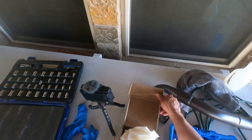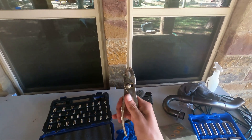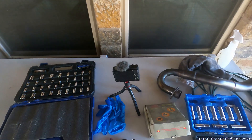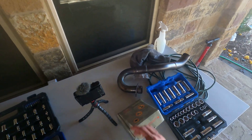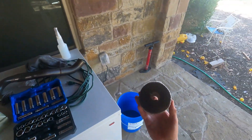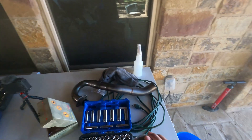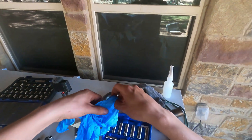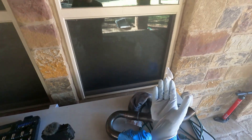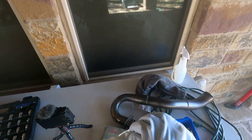Just got all this cleaned up. Now what we're going to want to do is get the heat wrap out. Some of the tools you're going to want are some wire cutters and some clippers. You're also going to need some gloves because this is going to have a lot of fiberglass inside of it. Once you wet it with water it should help with the fiberglass not going everywhere, but you're still going to want to be careful because it could get on your hands and face. I'm going to do double gloves — even though it's crazy hot out here — I'd rather have the extra protection.